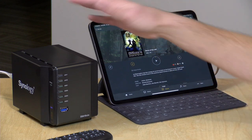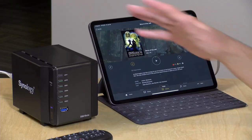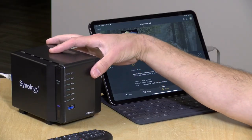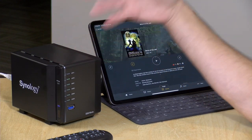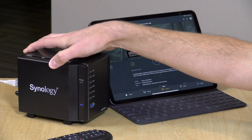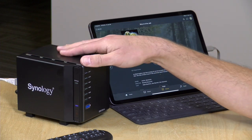What you might want to consider if you're in the market for a $300-ish device is the DS218 Plus. We reviewed it a few weeks back — it's larger, runs on desktop hard drives, is a little bit noisier, and only supports two drives, but it has an Intel processor that supports hardware transcoding. As a result, you can do everything you might want to do with a Plex server for less money, and desktop hard drives are a lot less expensive than the solid state drives in the 419 Slim. So it's not a great media server — it might be good for a dorm room or a traveling photographer.